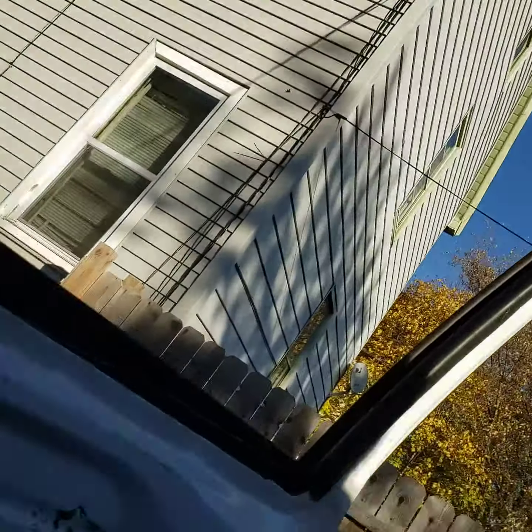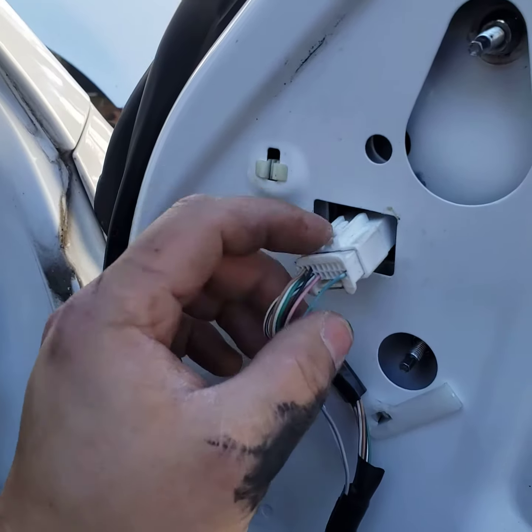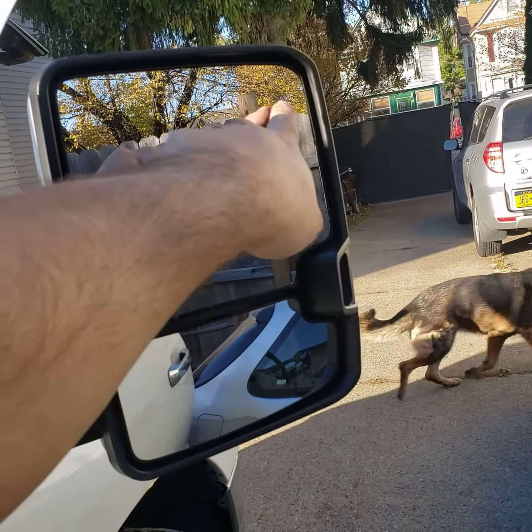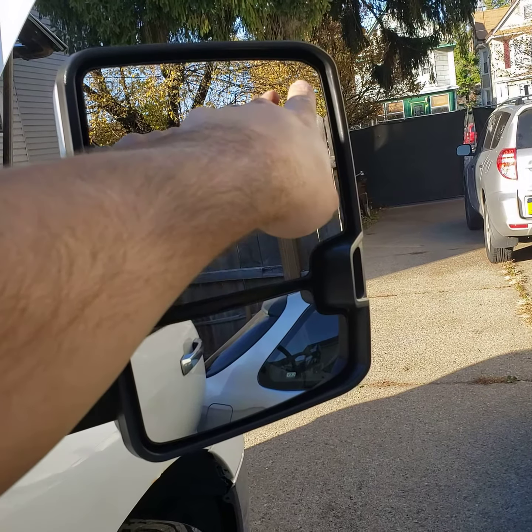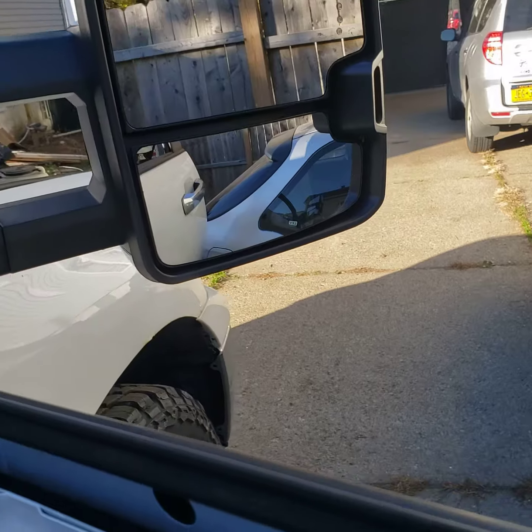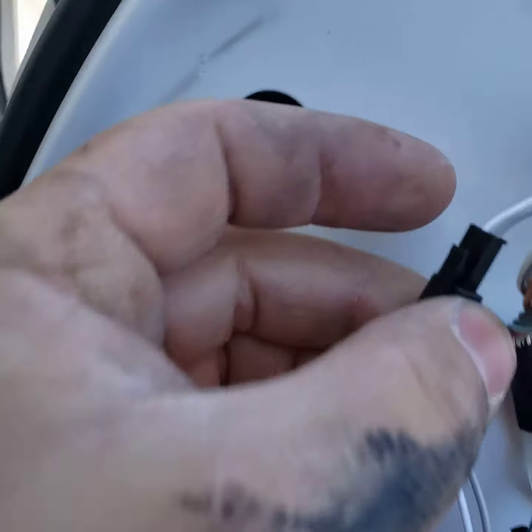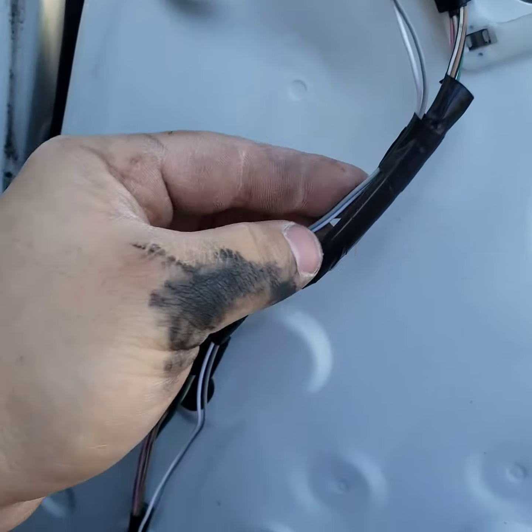I ordered the most plus tow mirrors for my 2010 Tundra. I couldn't spend a thousand on tow mirrors, so I got the first one installed. When you hook up the harness, the turn signals work automatically and defrosters too. The blind spot does not — you have to hook up an additional sensor, so I have to do some research on that. The reverse lights do not work either, so that's what these pigtails are for.